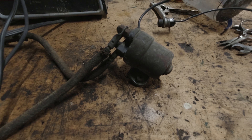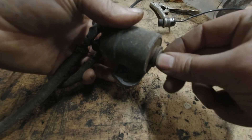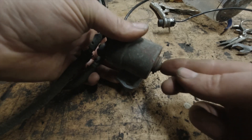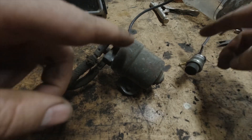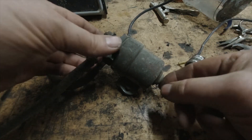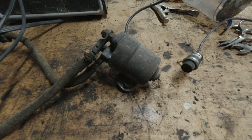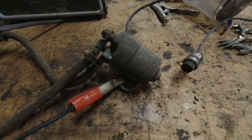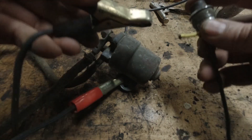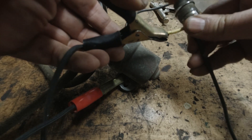This makes things a little bit easier. What I ended up doing — this part here had rusted in place, and that needs to move up and down. Basically there's a magnet, so when you push the S button it engages the magnet. It pulls this in, which then connects these two together and lets the power flow. We have positive earth here, and then we have the battery negative going up to the switch. We push that and that pops in.